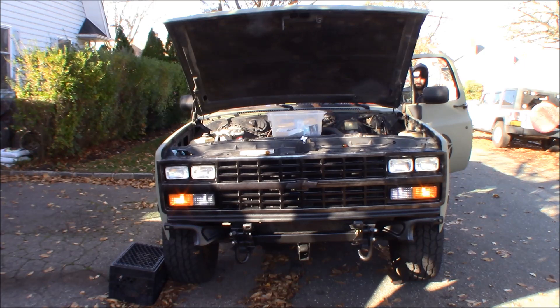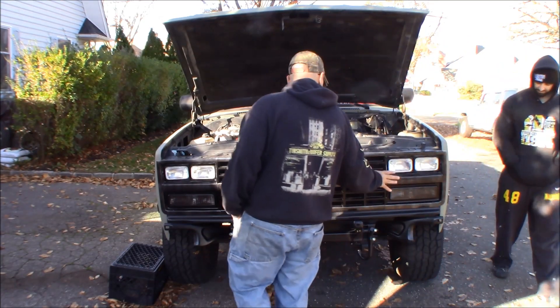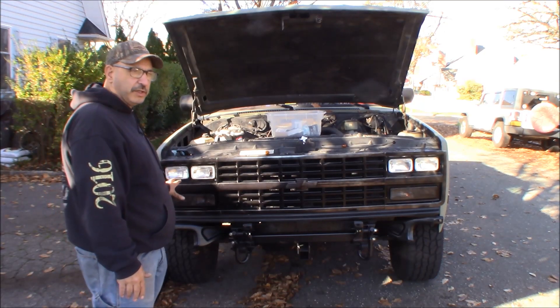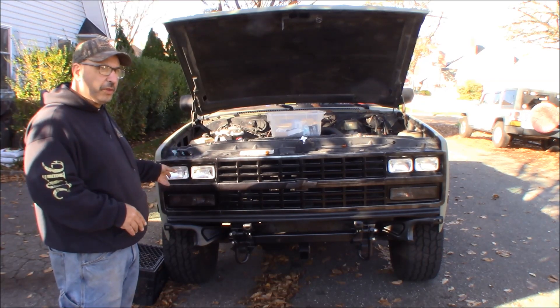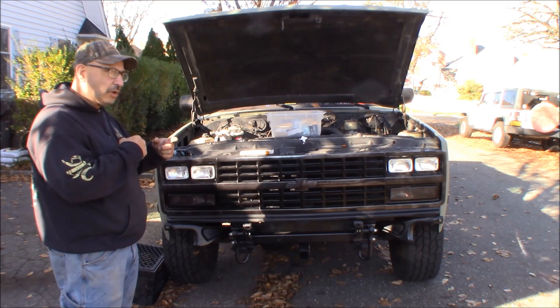All right, now start the car. With the car running, that side seems to be working fine. But when we go to this side, it looks dim — you're not sure if it's dim, could be the sun hitting it at an angle — but then when we start the car up, there's a problem here but not over there. This side doesn't blink at all when the car's running. I already tried swapping the bulbs from side to side, so it's not the bulb.